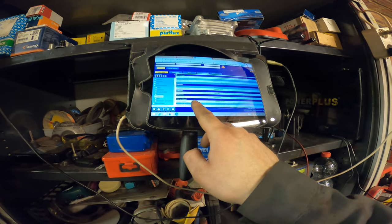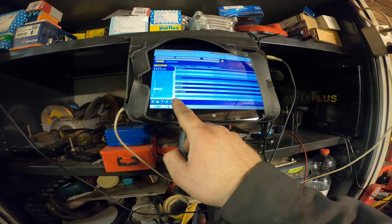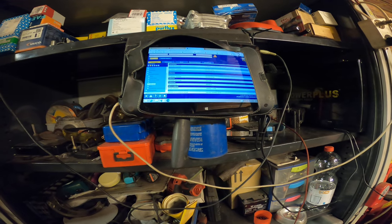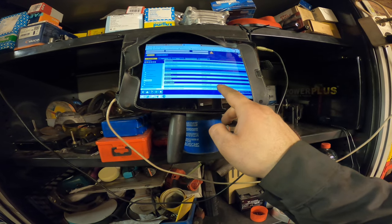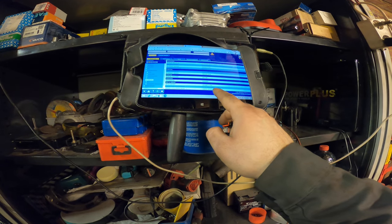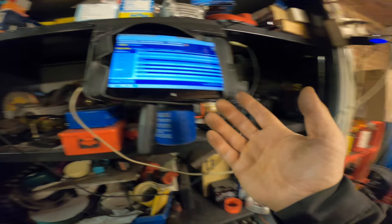So the wheel — wait, wait a second. It's the same thing. The central nut is 300 Newton meters, and the bearing is 180. But the bearing is inside, the central nut is on it.